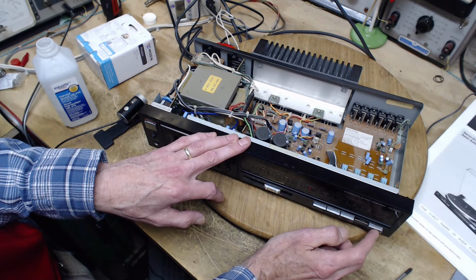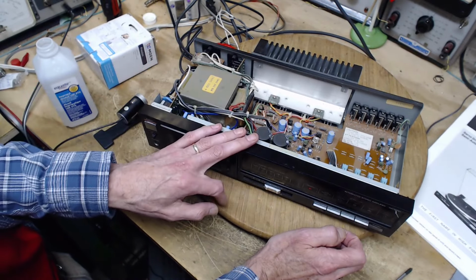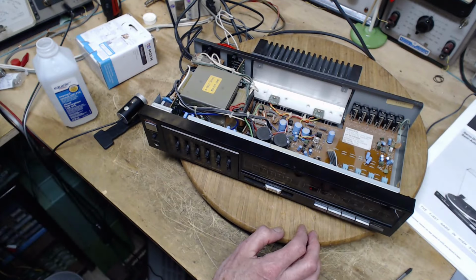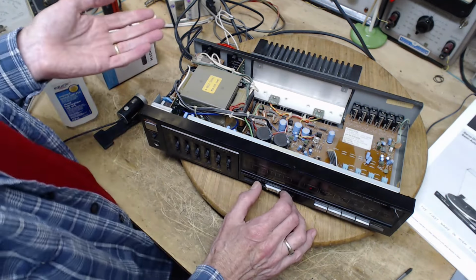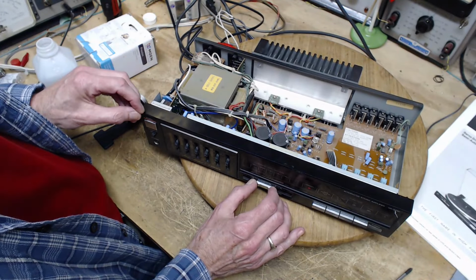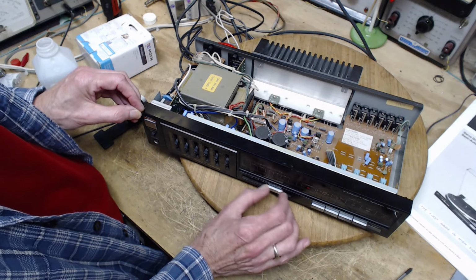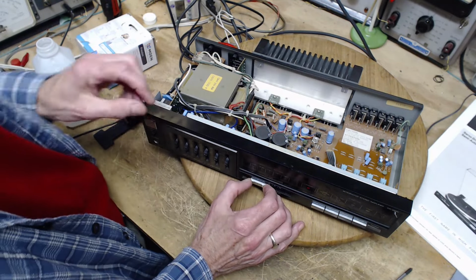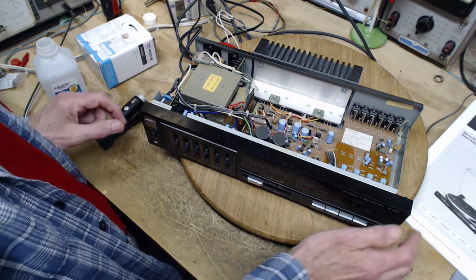As soon as you click it to phono here, I'm sure you're engaging a preamplifier. And that's not very good. It's making that kind of hiss. Now, the volume's up pretty darn high, like way high. So if we were playing a record, that's all you'd hear is the record. You wouldn't hear any of this hiss. Because, you know, normally we're down around here. I'm listening to the sound of the crunch as I move this. It's exactly the same every time.